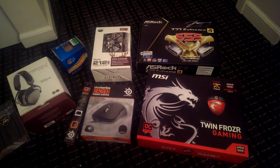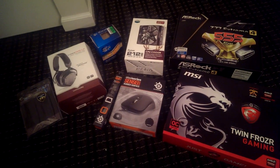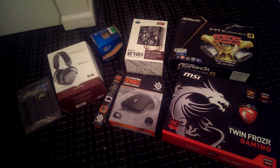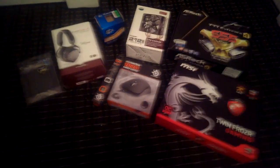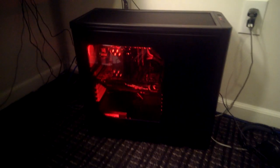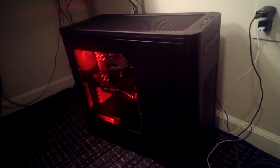And lastly, for a monitor, I am running an old-school Samsung 245BW — it's a 24-inch, 1920x1200 Samsung gaming monitor. So I'll walk you guys over here and show you the completed build. Don't mind my messy room. There it is — the Fractal Designs case. Don't mind my cluster of wires — I just slid it out so I could show you guys. If you check on the front here, this is that removable filter I told you about. Push on these corners — it's got some release pins. And inside, I've got two of the included Fractal 140mm fans. You've got 240 and 280mm rad support.